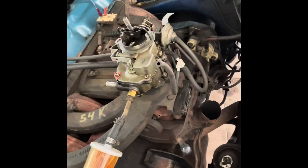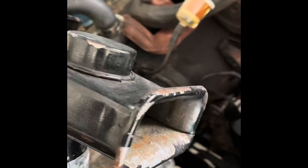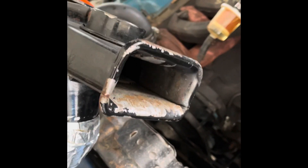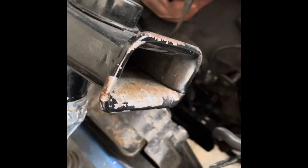As the engine warms up, it doesn't need all that hot air and needs to blend it with outside air from the snorkel — cooler air, not necessarily cold. That is connected to vacuum, but if it was just connected to straight vacuum it would work whenever there was vacuum. Under wide open throttle, when you lose vacuum, that damper valve closes — and you don't necessarily need all that hot air under wide open throttle. But they added one more thing in line, because that system by itself wouldn't know anything about temperature.